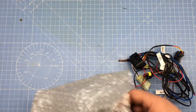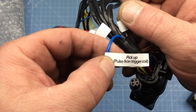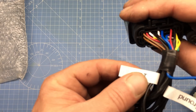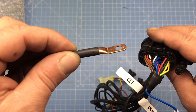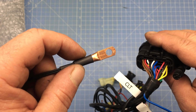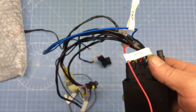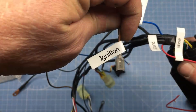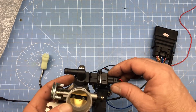So this looks like the harness and the ignition module. We've got a ground wire. The blue wire looks like the ignition pickup wire, or also known as the crank position signal. CLT — now that's the coolant temperature sensor, except the 420 doesn't have any coolant. So this would most likely have a thermistor in it and would bolt to the cylinder head, so technically this is the cylinder head temperature sensor. We've got key switch, and that would be switch 12 volts from the battery. Now, this ignition wire would go to the positive side of the CDI coil — at least I think so, I have to double-check that. So let's hook up some of this stuff to the ECU and see what's left over.